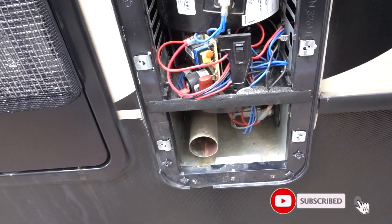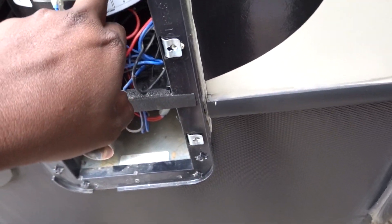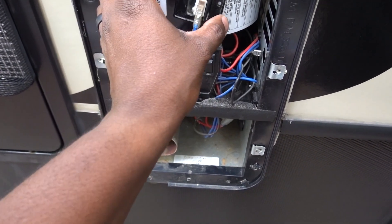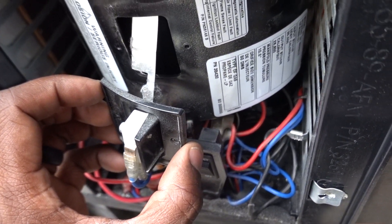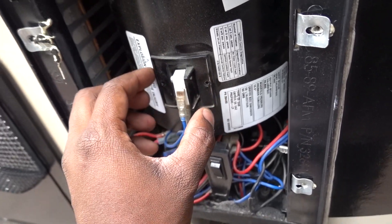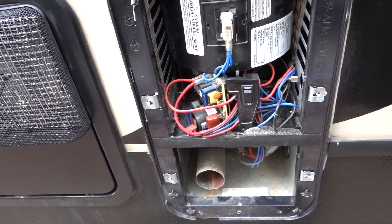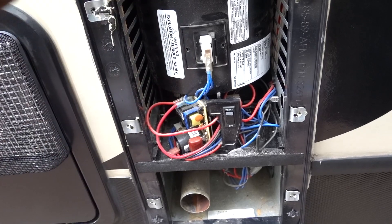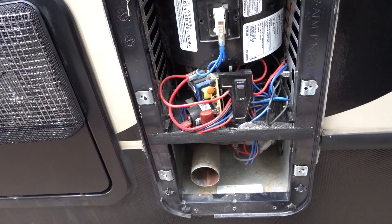Because it's out of warranty and I don't really want to pay anyone right now, I'm going to do some simple maintenance. One of the biggest things you have to look at here is the sail switch. You can kind of see there's some lint on this. The sail switch is probably the weakest link to any furnace. My RV tech told me that nine times out of ten whenever there's an issue with the furnace, it always starts with the sail switch. I've had mine replaced twice before we moved in full-time.